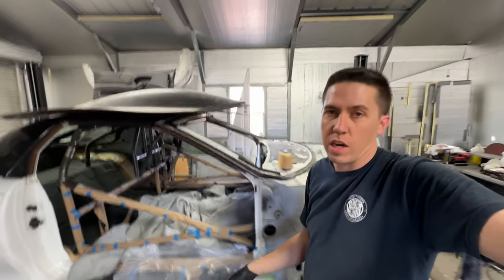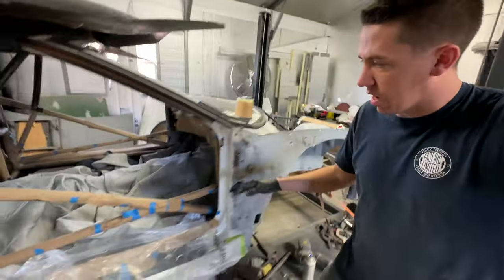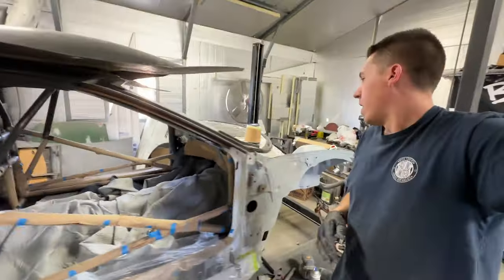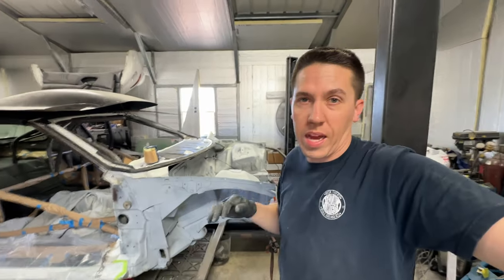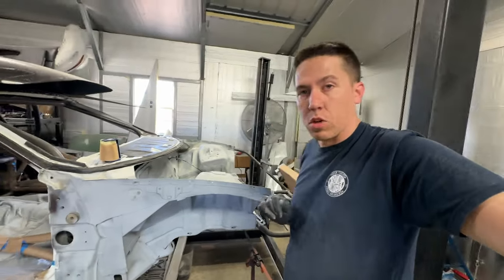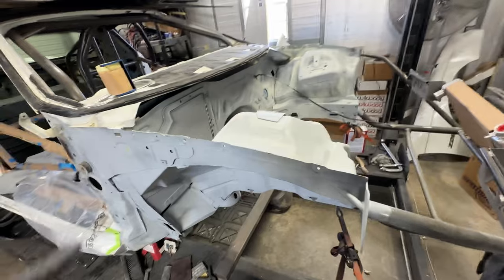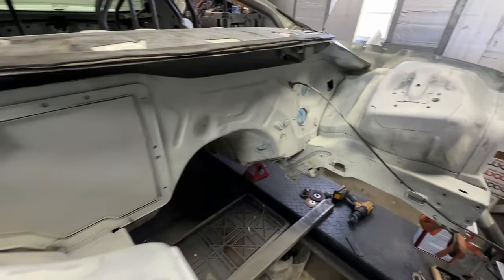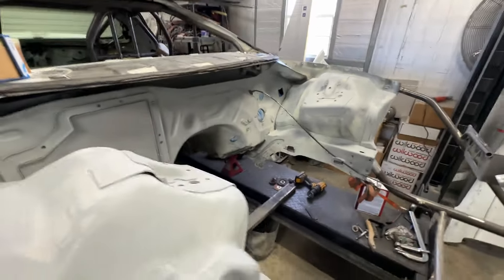In the last video we sprayed all the interior with the ceramic coating Lizard Skin and now I've kind of taped off stuff there, blinking and protecting it, and I want to start painting all the engine bay. Over the last day and a half I've really been going through and welding up any last little spots, grinding those smooth, ended up adding a little bit of primer to the bay on any of the bare metal spots, and just starting to clean everything up and smooth everything out.